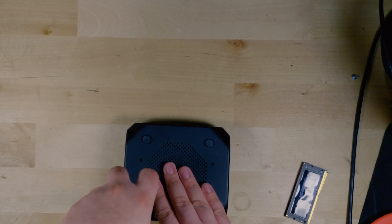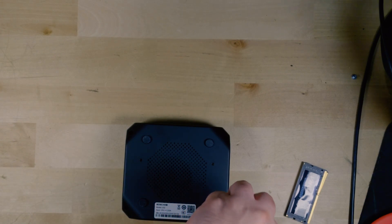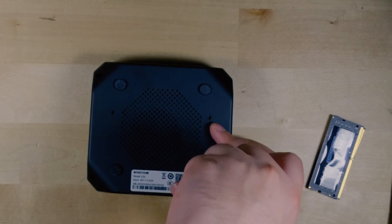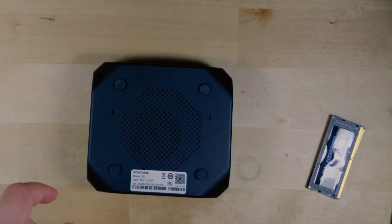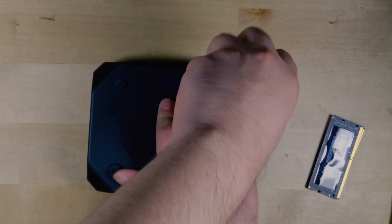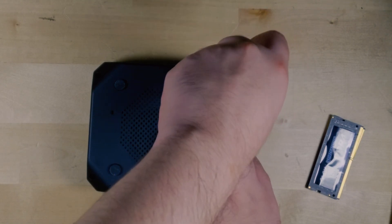The way we get inside here is by undoing the screws on the bottom. Unfortunately they are very recessed — not every screwdriver is going to be able to get in there. You need one with a pretty narrow and long neck. Thankfully, the iFixit kit screwdriver works perfectly fine, and because it's a magnetic tip, it helps even more to get the screws out.